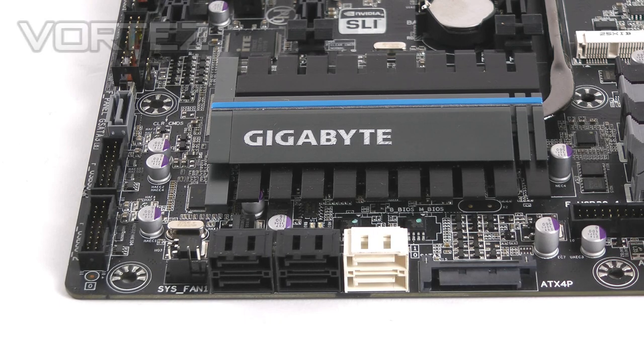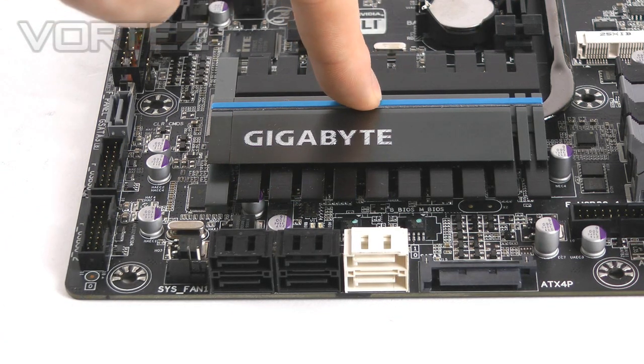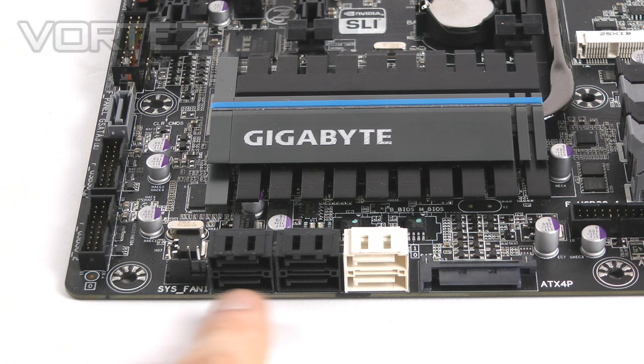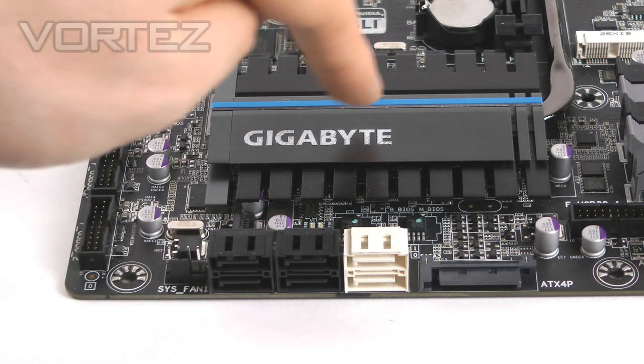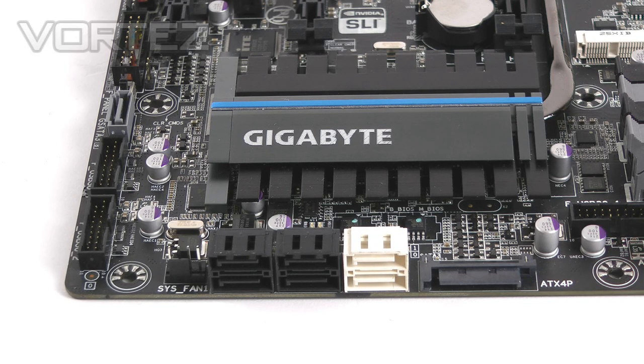Moving along, we come to the storage ports. We've got a combination of SATA 2 and SATA 3. The two white ports are SATA 3 at 6G. Now you'd typically get an additional block from ASMedia or Marvell on a Z77 motherboard, but we don't have that here — just the one stack provided by the Z77 chipset. Then we've got four SATA 2 ports, also via the Z77 chip. There's also an auxiliary PCI Express power port next to these, which gives you extra juice for a dual card configuration — rather than the Molex connector you might have seen on other boards, they've used a SATA port here.